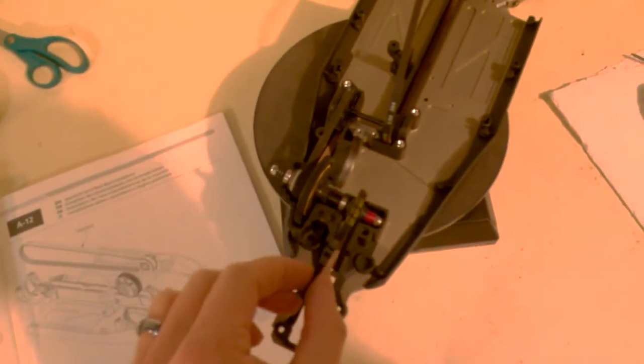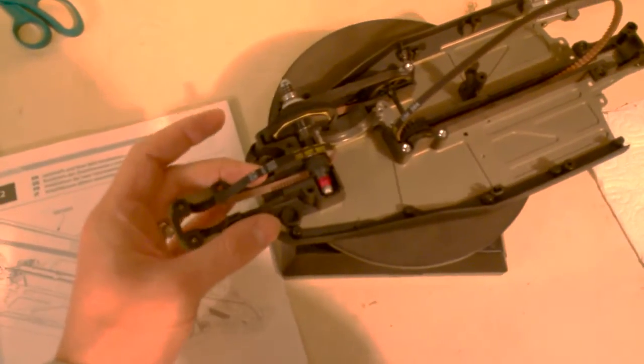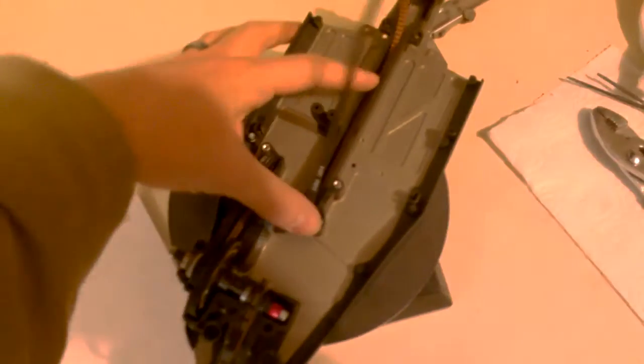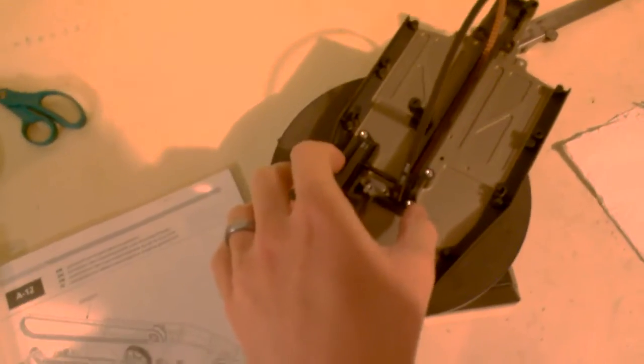So it seems a little strange, because you'd expect each belt to wear in and eventually start to loosen up. So I would expect the front diff to start slipping along the belt if this belt loosens up, and I'd want to be able to adjust the tension there. But maybe Team Losi found that the front belt is actually not a problem. Maybe you don't need it to be adjusted. I don't know. But I can tell you that this is a non-adjustable tension here, but the center belt and the rear belt do have adjustable tension. You get, I think, a bag H somewhere in here with all the different parts that you need to adjust over the entire tension range for both the center and rear belt. So it's very nice that they included that.